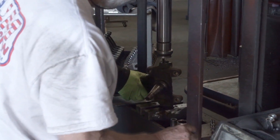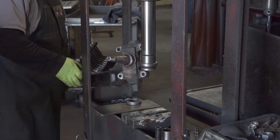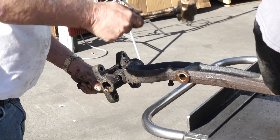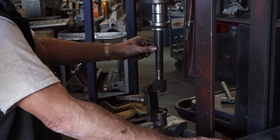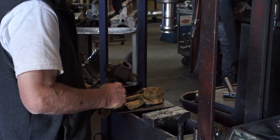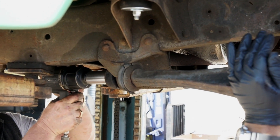Make sure to remove the lock bolt from the beam — this bolt locks the kingpin in place and keeps it from moving up and down in the spindle. Also note the position of the kingpin bearing; you will want to put your new bearing in the same position. If you used your local machine shop to remove the kingpins, have them also remove and replace the kingpin bushing. Back to the truck — you're most likely going to need to replace your radius arm bushing.